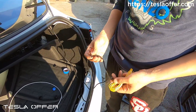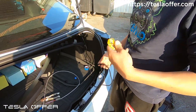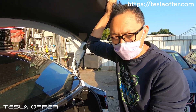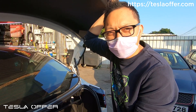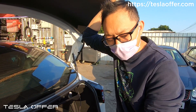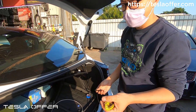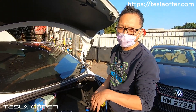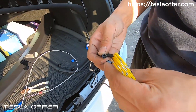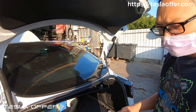This is for the extra option: to get the signal from the CAN bus to prevent the foot sensor from activating when you're driving. The Tesla car has a factory protection feature — if the car is moving, the trunk will not open even if the foot sensor tries to open it. But when you slow down and drop the speed to zero, there is always a risk the foot sensor gets activated. This extra option ensures the foot sensor will not activate when the car is in drive mode. You connect it from here, then run the remaining wire to the back of the center console, and connect to our CAN decoder.